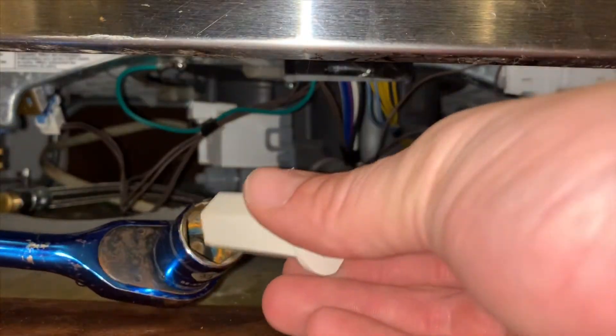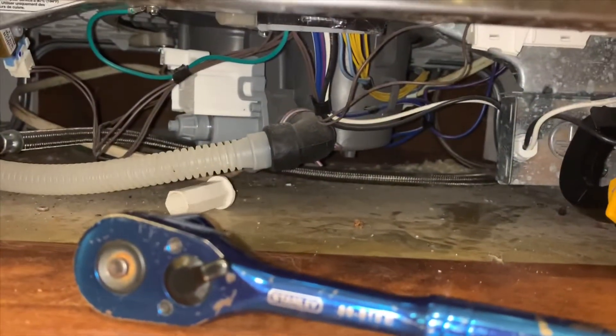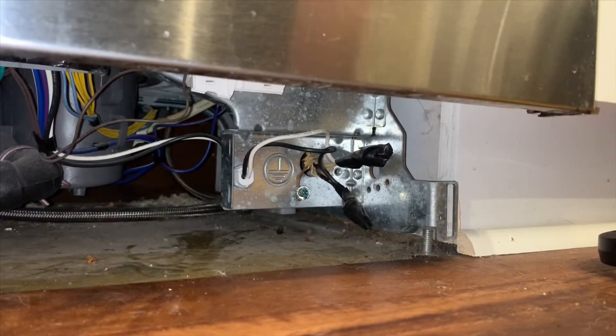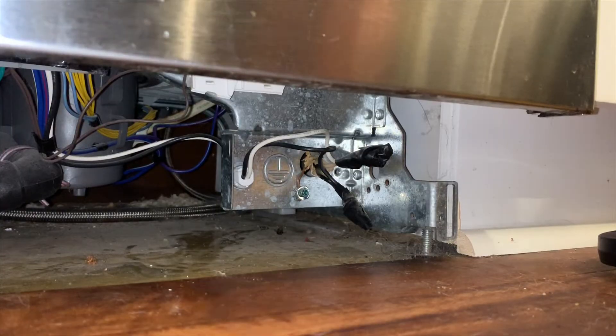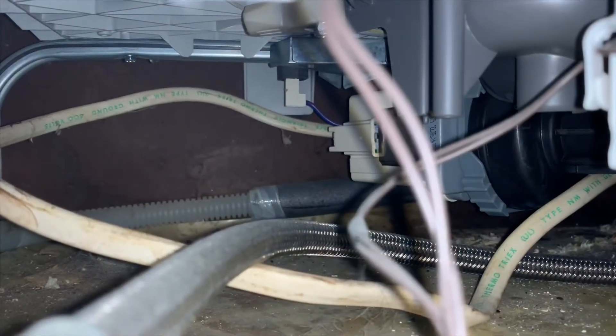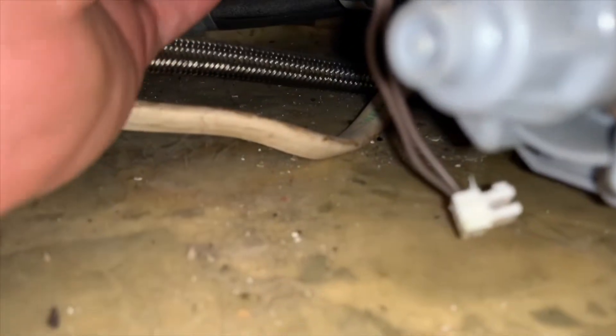We are going to go ahead and swap this element out and put a new one in. To get it off, you need a three-quarter inch ratchet — there are nuts on the back side. It's a lot easier to do this with the dishwasher uninstalled, but I hate uninstalling dishwashers, so I like to do it the hard way. As long as your arms are skinny enough, you can get back there and get those nuts off. Remember, folks, whenever you get the testing done that requires power, whenever you start to work on things — whether it's taking off a drain pump or heating element — you always want to disconnect power. Go ahead and turn off the circuit breaker before you swap out your heating element, control board, thermal fuse, or whatever it may be.